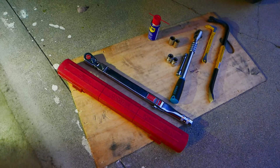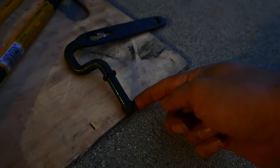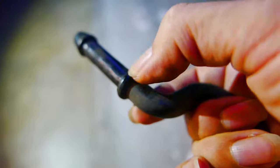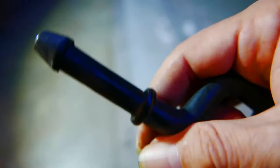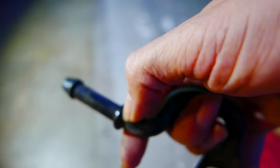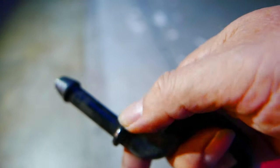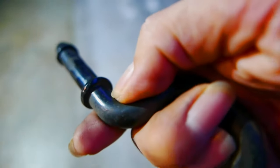hangers. Okay, 2 of them look like these. So the hangers are here. One thing I want to mention, which I did mention in the video actually, that's holding it in one end. But there's also this other little flange which you can't really see. And when you have it all the way across, I'll explain in the video, be careful you don't get your pry bar behind this. Because then you're not pushing against the rubber, which you're trying to clear and kick off. You're just pushing against this, which is welded onto this part. You're not going to break that loose.